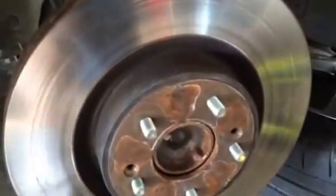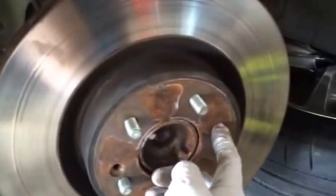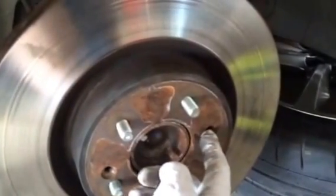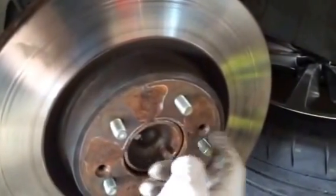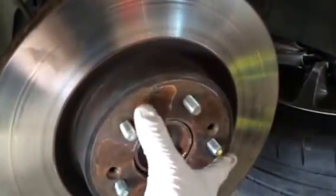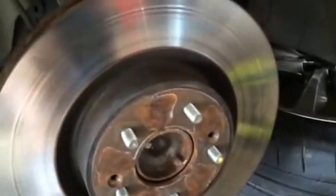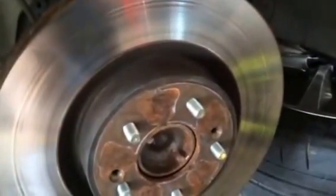And that's something he didn't explain. Be careful when you take these screws out with the roto hammer — once you get it to spin, be gentle, because if you screw up the threads you won't get them back in. It's not totally necessary that they go back in since the wheel holds the rotor on, but it makes putting the caliper back on a little bit easier.